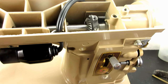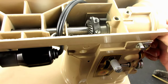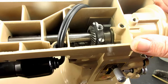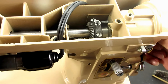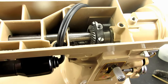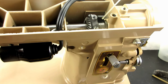And if later when the machine's all oiled up and moving freely, I might even have to add more. But if some, see now the machine has frozen again. So if that happens, like I said, don't panic. Okay? The oil can even kind of leak out of these bushings a little bit. And that's okay. It's only oil. You can wipe it up with a rag later. But you want to be sure after a wash and dry that you give it plenty of oil.